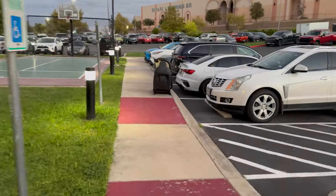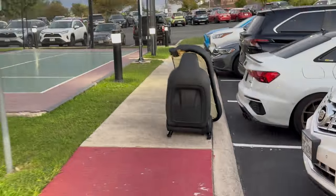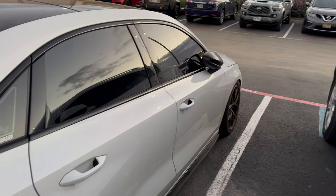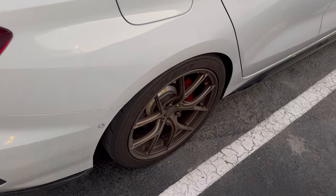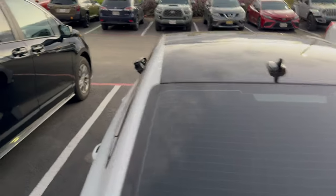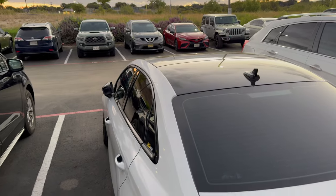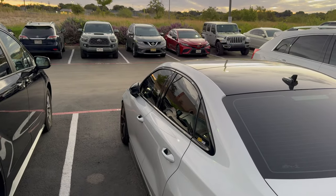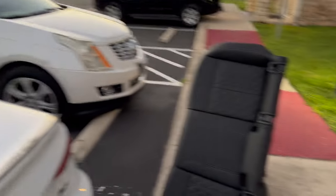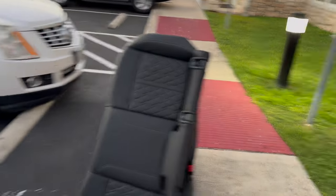Seats are out — I forgot I wanted to stack them and get a picture. Taking them in and we will go warm this baby up. We'll try and do a Haldex adaptation. Tire pressure is down, they're at 30 right now, getting down to about 22. I'm gonna have all these dash lights and errors. Hopefully it still lets me turn off traction control — I disconnected the seat sensor once just to see and it was so annoying within 30 seconds that I plugged it back in.